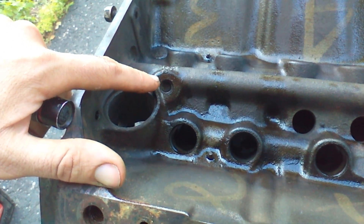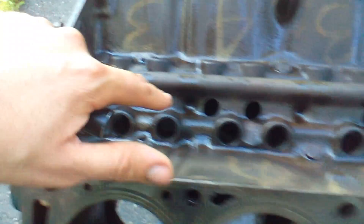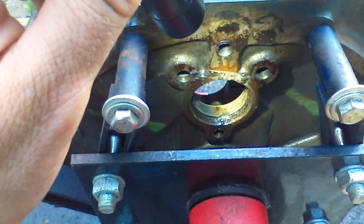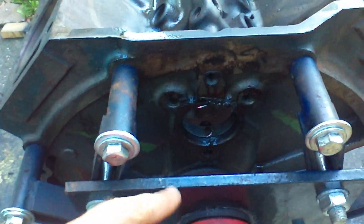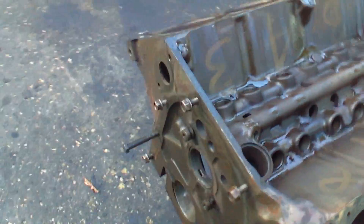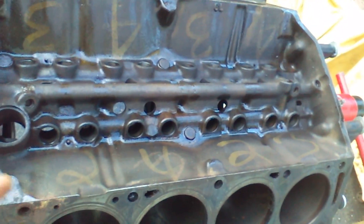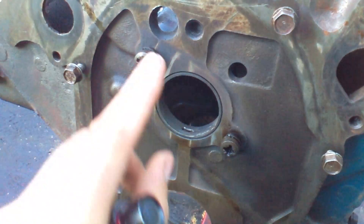You can see there's a plug in here — it's like a freeze plug, a little guy. There are a few of them throughout this engine: one right here, one right there, one right there. Then back here, most engines have tapped holes where plugs go in — just tapered pipe plugs you take an allen wrench to crank in. Those are pretty straightforward and obvious. The oil galley holes that feed the hydraulic lifters go through one end of the block clear out the other, and the center one has a pretty obvious plug right here.